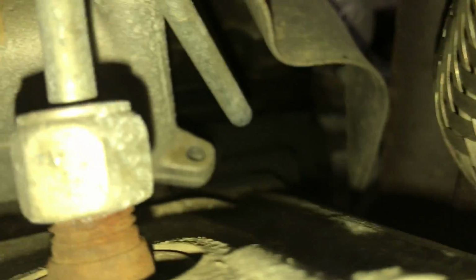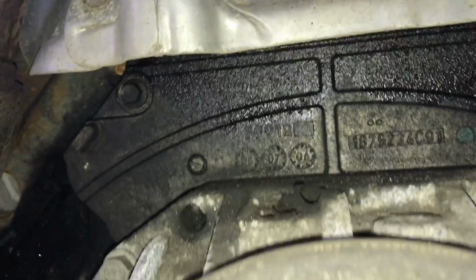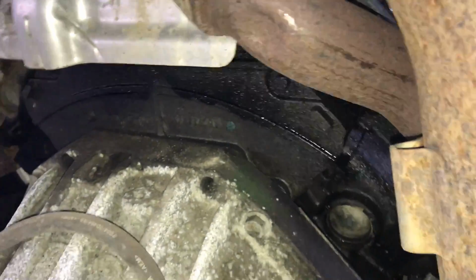We're going in to replace the under cover harness. Now who knows further down, you know, it's just an oil leak. I mean, this wasn't a profound oil leak. It wasn't something really big that was a complaint. But, you know, while we're here, it's time to look, keep your eyes open and address stuff. Because the fact that that's all glistening, well, some of that is just coolant from us, but that it's all glistening right there and it stops, kind of says, hey, we might have an under cover harness physically leaking oil. I mean, it could happen.